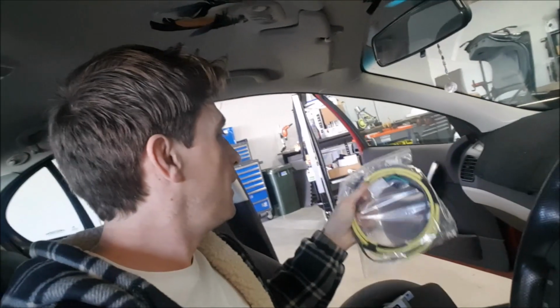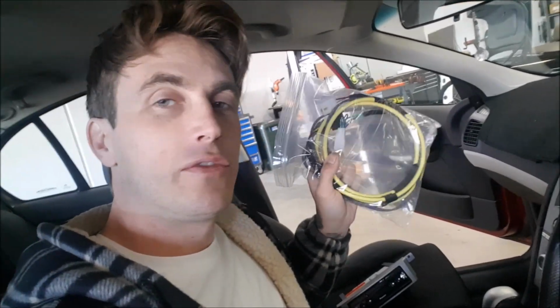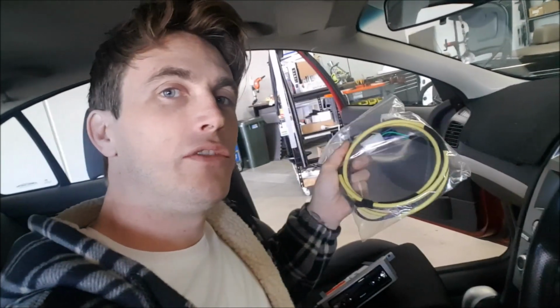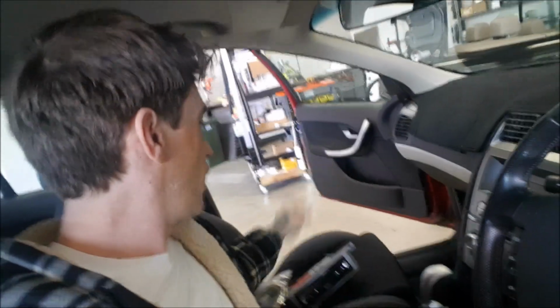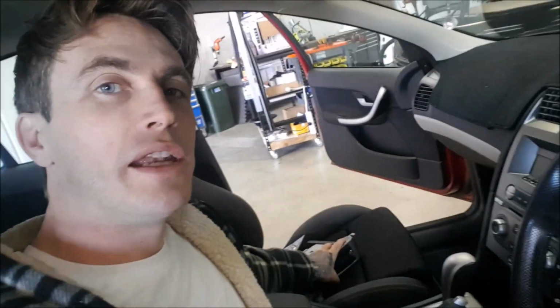First of all, you'll have the mounting kit and the Pioneer head unit, which is also supplied as a kit from Universal Fuse. Comes with that is a UF1 interface cable. This very clever cable, which is unique and exclusive to Universal Fuse, will let you plug and play this head unit to your Ford Falcon, BA BF or Ford Territory, and requires one more little adapter, which is a Pioneer specific plug, which attaches to the end of this and then connects to the Pioneer head unit.